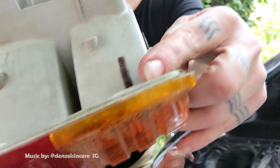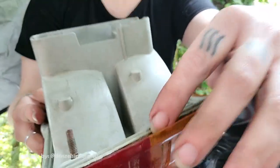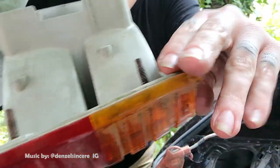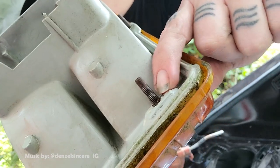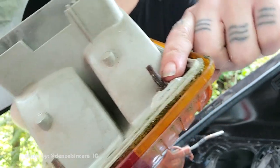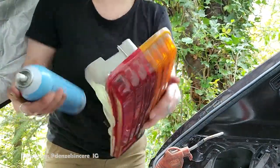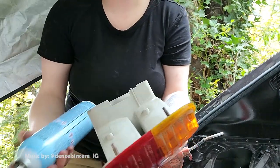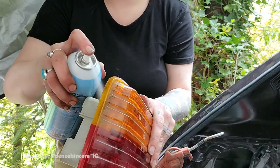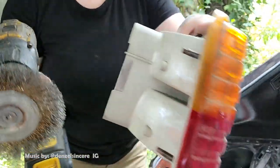See that? I mean, you see the stuff inside, ignore that. That's going to get cleaned. But this. So the reason you're probably breaking bolts is because you don't clean your bolts. So a habit that I've been getting myself into for a very long time now, I'm glad, which Tyler has taught me, is to clean the crud out of them before you bolt anything back in.